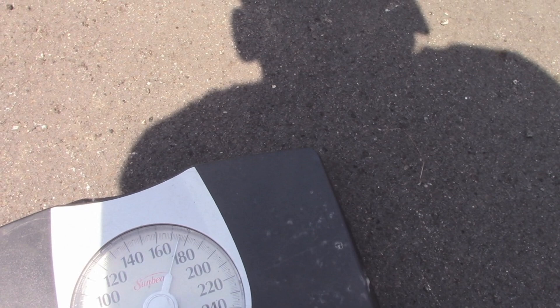So if you look at the scale, we have — I'll call it 175 pounds. Take 175 — I'm doing this on my phone because math is not my strong point — multiply that by five, and it gives me 875 pounds on the tongue. And that is all there is to it.